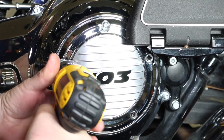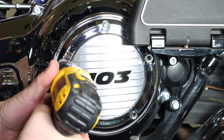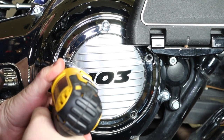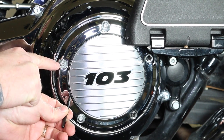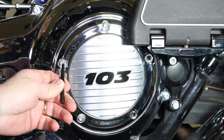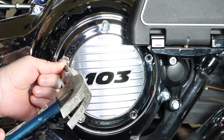You don't have to drill in all the way — just drill in maybe an eighth of an inch or so. We've got our hole drilled in there, about an eighth inch deep, maybe a little deeper. Now we've got our extraction tool, or back-out tool, whatever you want to call it. I'm going to put that tapered end in there and then simply start hammering this in.